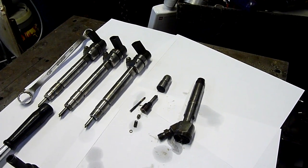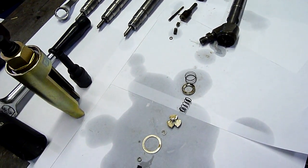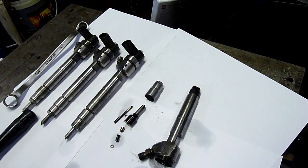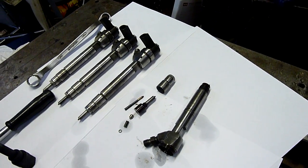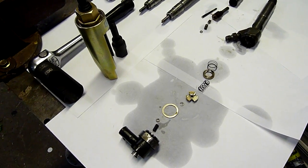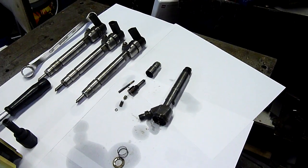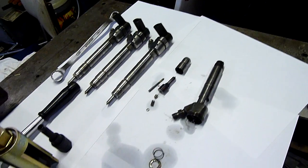The whole car got junked because they just ran it far too long with a wrecked injection system and completely rooted that engine. The OM612 2.7L common rail diesel is a very solid lump — they're a good engine, but if you let ancillary stuff go bad for too long, you'll destroy it and they're not cheap to replace. These came out of an ML270. The fifth injector — the seller was only selling four out of five — I'm guessing it was either permanently stuck in there or destroyed. I'd say this engine was just run into the ground.